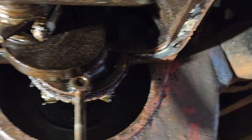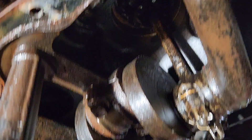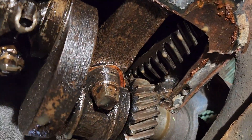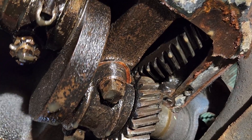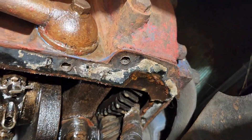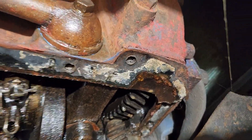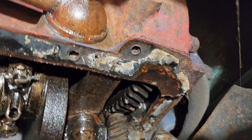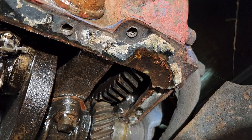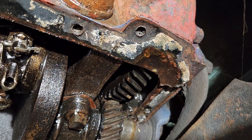She can use new gaskets. Here comes Shop Cat Lizzy — she's going to give this thing a CAT scan. Look at that fiber gear up there. We're going to replace that, because by replacing this seal on the bottom of the pan, I'm going to go ahead and pull the front, because I'm going to service all of this motor. So by pulling the front, I'm going to put a new cam gear in — just because it's a smart thing to do.